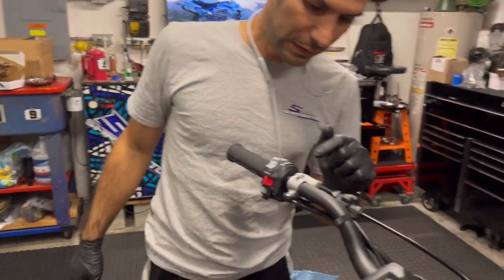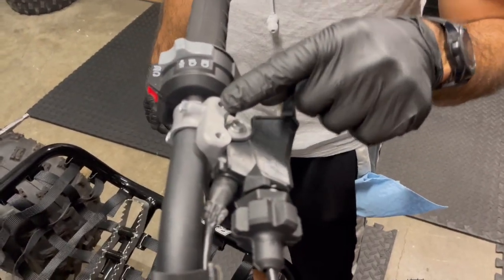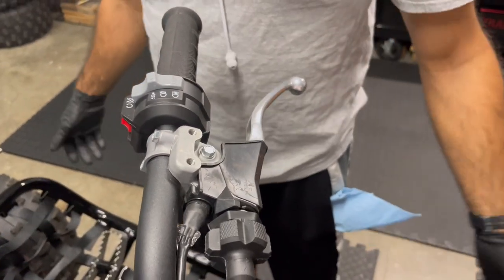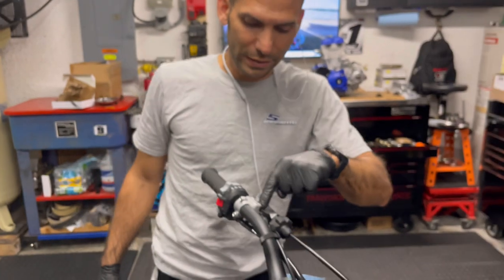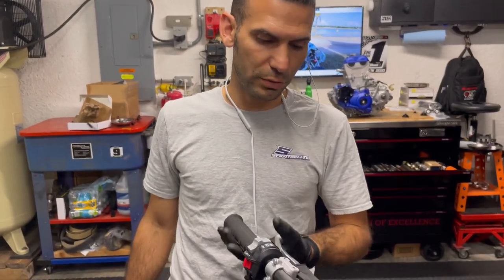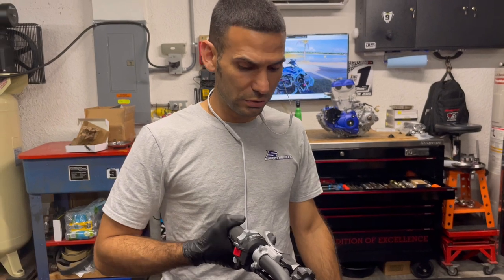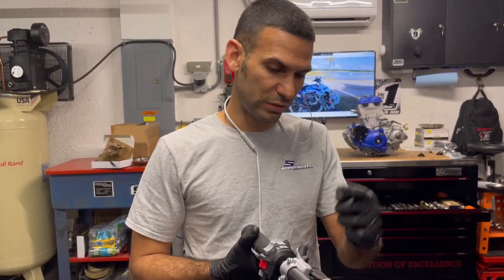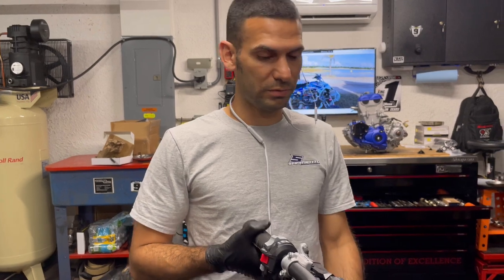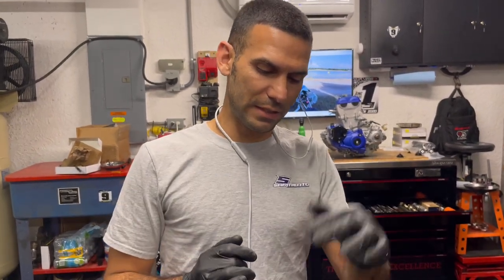For racing we just don't need it anyway. I haven't had one of these in ages. Also, I was asked what to put in the holes where the parking brake cable was — you could put the factory bolts back in, or lighter than bolts, you can put some silicone in there to keep water from getting in. It's not actually going into the clutch perch physically. If you replace your clutch perch later to something with a bearing system or something different, silicone works good — black, clear, silver, or gray silicone. Silicone is lighter than a bolt, so a little dab keeps contaminants out.